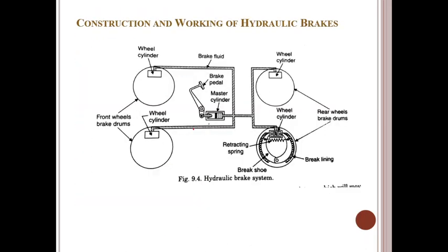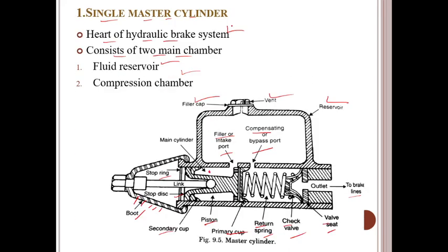In this diagram, this is the master cylinder, and these are the wheel cylinders — nothing but the slave cylinders. A piston moves along the bore of the master cylinder. This movement is transferred to the hydraulic fluid, resulting in movement of the slave cylinder. The hydraulic pressure created by the moving piston inside the bore of the master cylinder toward the slave cylinder compresses the fluid evenly, but by varying the comparative surface area of the master and each slave cylinder, one can vary the amount of force and displacement applied to each cylinder.